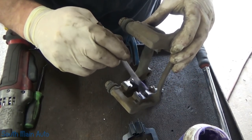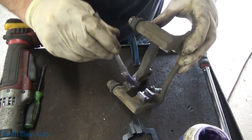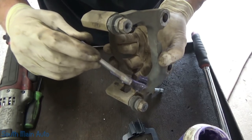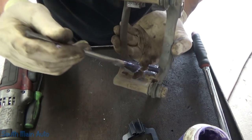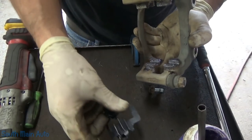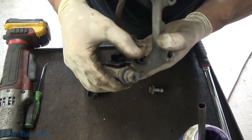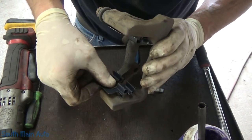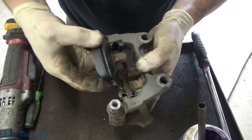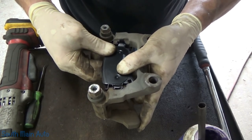There's a little bit of lube behind our hardware, as it is our habit, to prevent rust buildup. The hardware is stainless steel — it doesn't necessarily need to be lubed, but this is always the pinch point. This gets rusty, squeezes the hardware, hardware squeezes the pads, and then the pads seize in their brackets. So we'll install the new hardware — always install new hardware. Once installed, the pads should move freely and easily back and forth. You never have to grind or custom fit them.